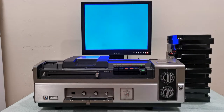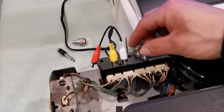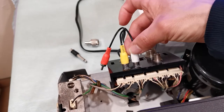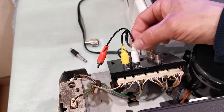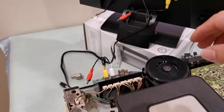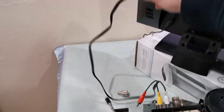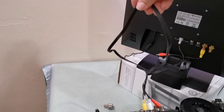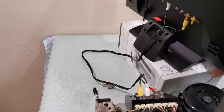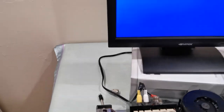That's a 4:3 aspect ratio. Let me show you which connections I'm using and recommend. I'm using the RCA composite video out, and also these RCA audio outputs — mono only, so I'm not using the right channel. That feeds into my monitor. As you can see, that's the RCA video in and the mono audio in. I didn't focus on a high-quality cable because this format is very limited on resolution — there's really no reason to use a high-quality cable here.